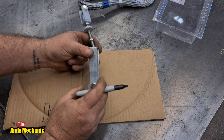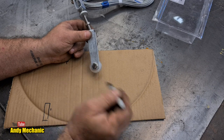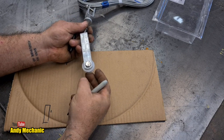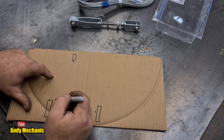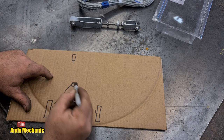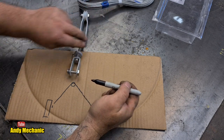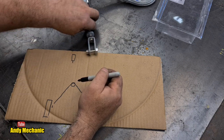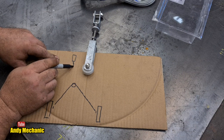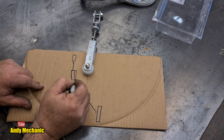Now, this bit is very, very important. This is a little pulley, and the cable goes through the pulley from one side brake to the other side brake. So when you pull on this, it equalizes the force to both brakes. Critical. So that cable somehow goes up here, goes round the pulley, and then it comes back to the other brake. Now, obviously we have, in this case, the link rod, and it's adjustable. So that way round, with the pulley down the bottom, basically coming down here. So you've got that component, oh, terrible drawing, that component down there. Let's just bring it across a little bit, there we go.